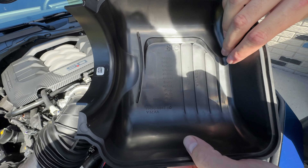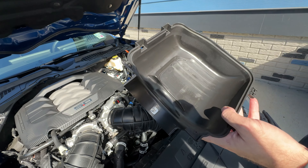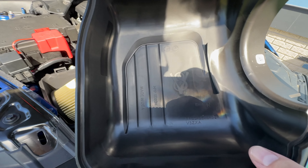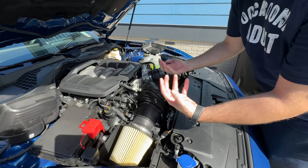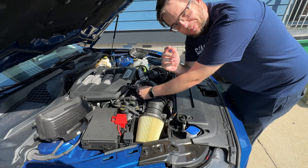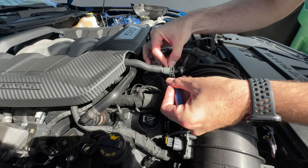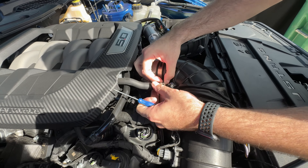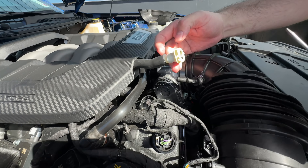Look at that — 'Made in the USA.' It's got all indications for the Mustang, the 460. It's got all the different cubic inch sizes for the Mustang. That's cool as heck. Now you see Ford putting all kinds of fun Easter eggs everywhere. So the next thing we're gonna do is pull these completely off so we can work with them on the bench in air conditioning. Push up on one side, grab the back of the clip, push down on the other side, and pull it off.